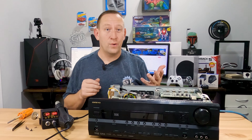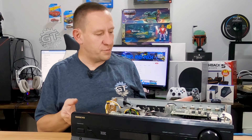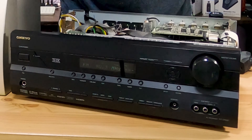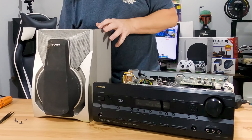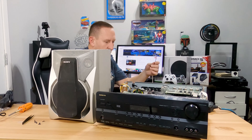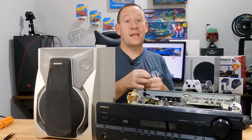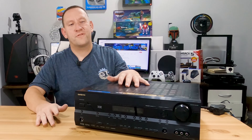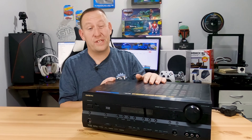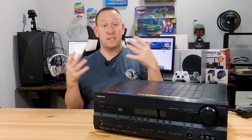We want the chip now to cool down to room temperature before we start putting power back through it, and then see if we're getting any output through the speakers. Before I put this back together, I can plug it in — should be cool enough. Turn it on. There's no antenna, so it's fuzzy. Let me stick this chunk of wire in here. I now do have sound. We've got the cover back on. We've proved that music now plays through from the tuner. That chip runs everything, so I have every reason to believe this would be fully functioning now because the sound wasn't working before.